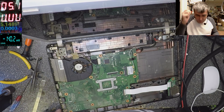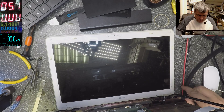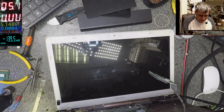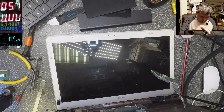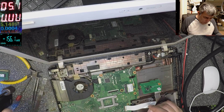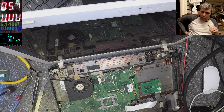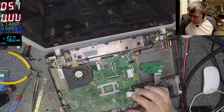Okay, it's on and it's not working. That's weird. Let's check the RAM memory — maybe this time it's not graphics, maybe we have a RAM issue. The fan is not spinning, and that's weird — it should be spinning even when cold. It's not doing anything. Let's check some voltages.